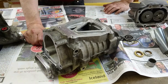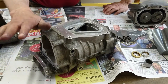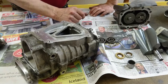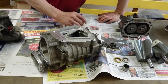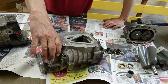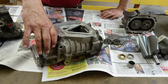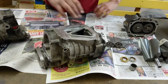If the charger comes in and the PTO is absolutely perfect, as it was on this one, you don't need to have that done. If the rotor pack is damaged, then you need to do that. If the nose is okay, we don't need to do that. You probably wouldn't go for all three, because then you'd be getting to the point where you wouldn't be far off the price of a brand new charger, which are £1,400 — or possibly even more now. So the need to be able to repair these properly is greater than it was.